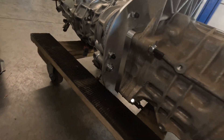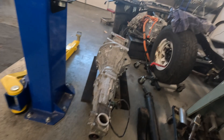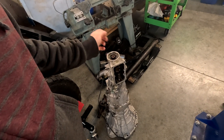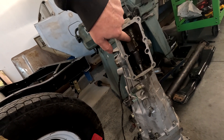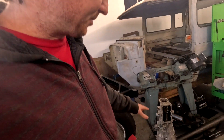We're confident it's going to work, we just need to sort through these issues. We also noticed with the transmission that it's stuck — the input shaft and the output shaft are both frozen, they won't rotate at all; you should be able to easily spin them by hand. Also it's locked in gear. This is the shifting fork and it's all the way to the back and it won't rock side to side, so I'm pretty certain it's locked in like first or third gear. Basically it's seized up.